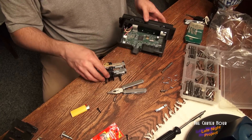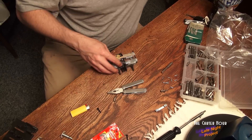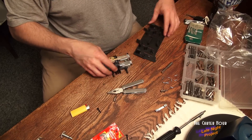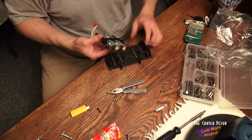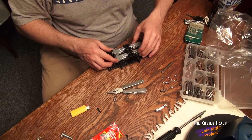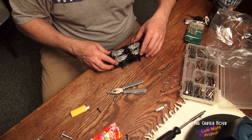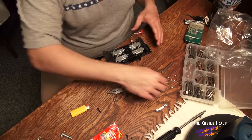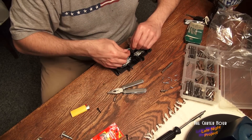Going into the cylinder, this black piece needs to be facing the inside, while the pitted portion needs to go towards the outside — towards the vacuum piece that we pull out and put the new O-rings on. Essentially, you slide it in, you have your spring, and then this piece goes in like that. The little pitted area here goes up against the assembly. Now I have the unit reassembled, with extra springs and an extra solenoid piece I can use at a later date.